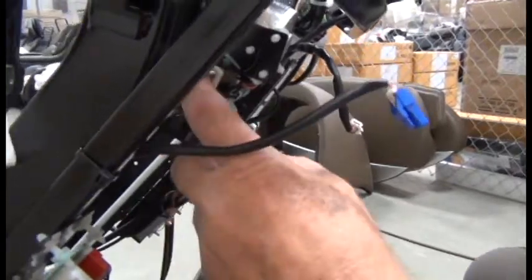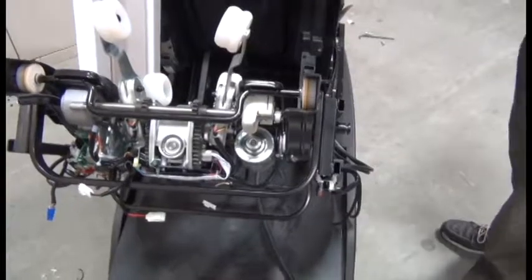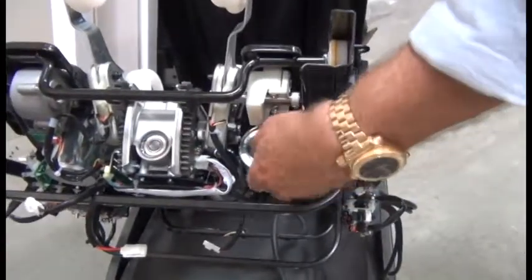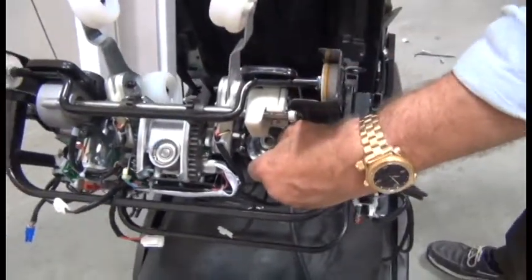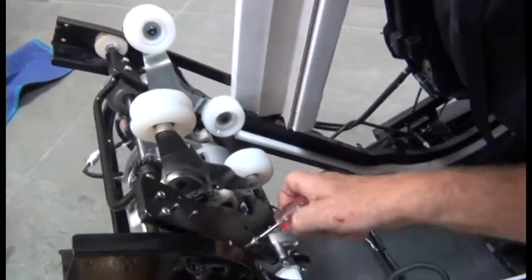And so now we can see that magnet below the sensor board, and that's as far as we need to go. The next step is to secure the elevation motor to the bracket next to it. First, we need to push it inward up against the bracket. Remember, we had pulled it out in order to insert the screwdriver to move the mechanism, and then to replace the four screws that secure the motor to the bracket.